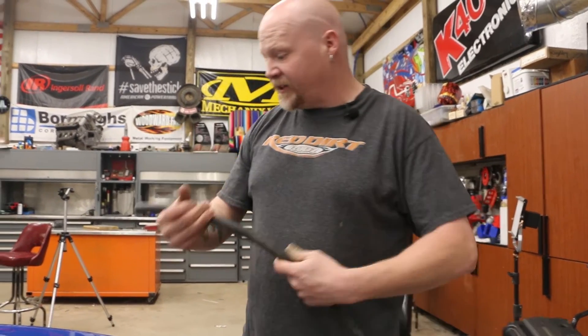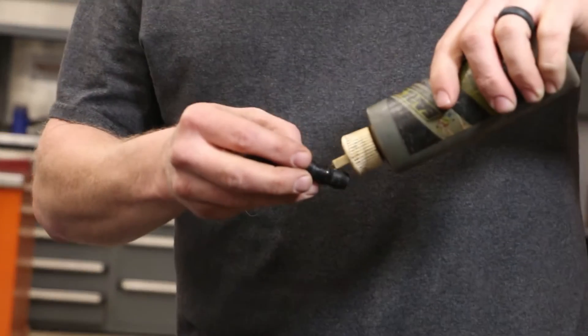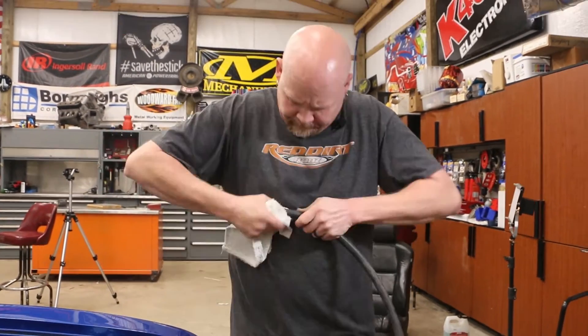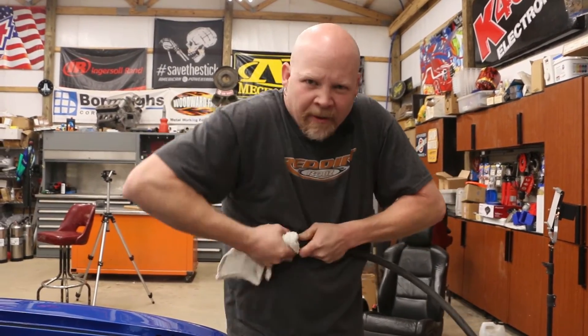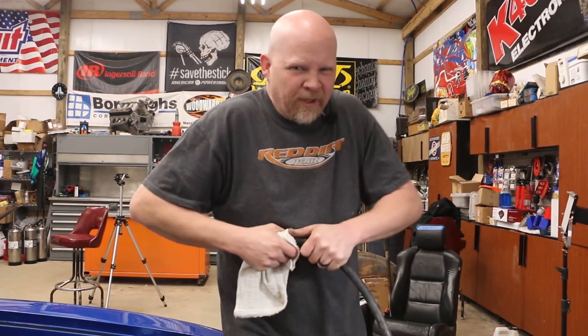Now we need to make our lines. We've got a length of Earl's half-inch super stock hose and this is Earl's assembly lube — just going to put a bit of this on the fitting. We take the hose, hold the fitting, and just push that on. Do you need to put a hose clamp on that? Nope. The beauty of this is these don't need hose clamps and they're good for 250 psi. If you're going above that, you can put a crimp-on style ferrule, but I rarely use them because you don't need them. And this is vacuum, so we don't need it at all.